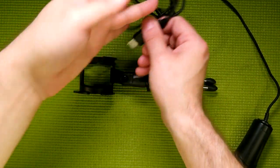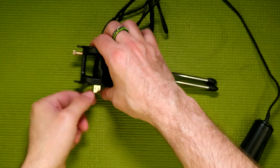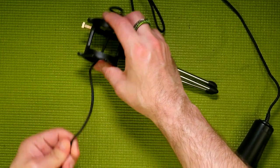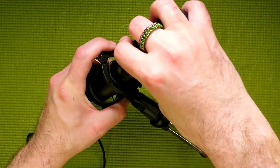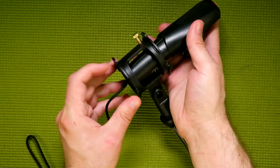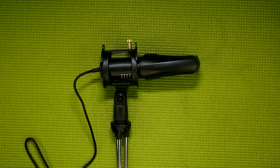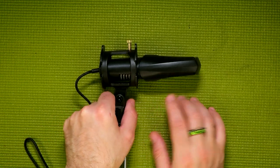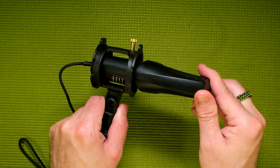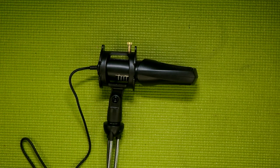Next up, run the microphone's USB cable through the rubber bands on your shock mount. This is easier if you uncoil the USB cable first. And once you have the cable all the way through, just go ahead and run the microphone between the rubber bands and you're set. For those wondering what a shock mount is — it is a mount for your microphone that is meant to absorb shocks. Every time you bump the cable, this is going to allow the microphone to bounce around freely without rattling, so you're not really going to pick up as many of those sounds as you normally would.